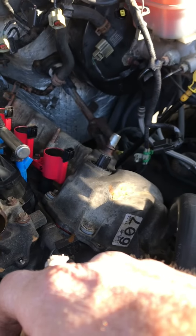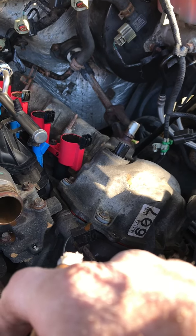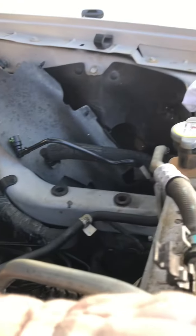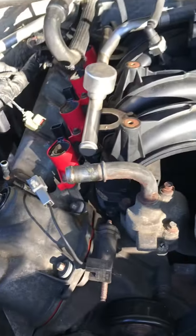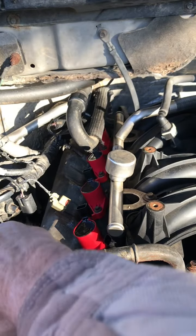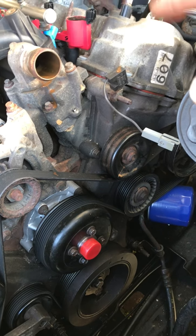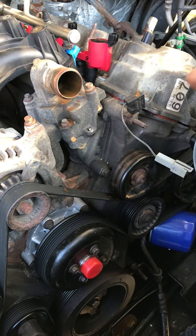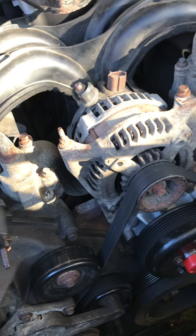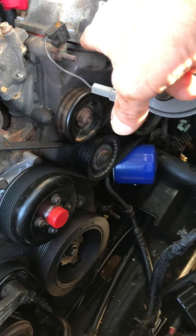I'm giving up. I've got to go in here and study to try to figure out how to take that apart. On my Chevrolet, I've got things that disconnect all this stuff. Let's put that back on. This sucker's got a blown head gasket and a possible dropped valve over here on this side. When I take that cover off, and this cover, and all this stuff right here, that chain will be broke on this side right here.